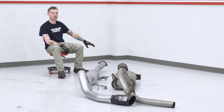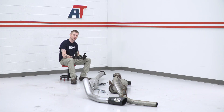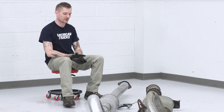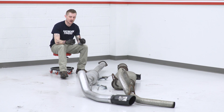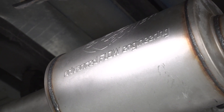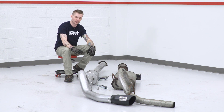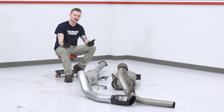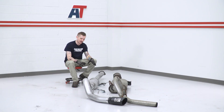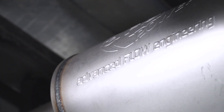That's really cool because on these turbo vehicles, this resonator is largely responsible for keeping those turbos quiet. So you'll definitely hear them spooling up with the new mid-pipe and you'll probably hear some of that nice back pressure and blow-off while you're driving around. Working back to the AFE muffler, this thing is super tiny — a lot smaller than the factory muffler. The factory muffler is baffled and chambered, which is no good for sound or volume. The new AFE muffler is pretty much a straight-through, shotgun-style muffler with one primary perforated flow tube and the casing acting as one giant chamber — very simple, very free-flowing.